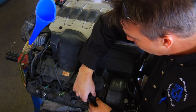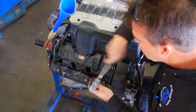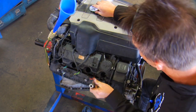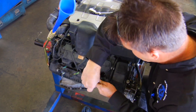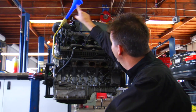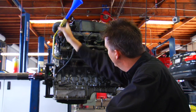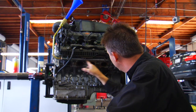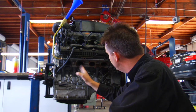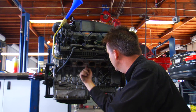While this is soaking, remove the ignition coils and the spark plugs from the car. It's important to remove the spark plugs so you don't risk hydrolocking the engine with fluid going into the cylinders. Now the carburetor cleaner has been soaking down through the special tool and into the galley, sitting in each individual exhaust port where the passage is blocked.